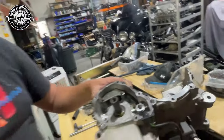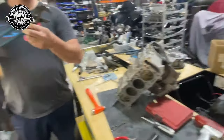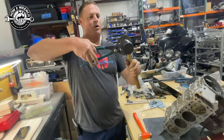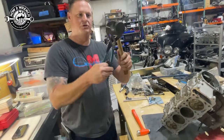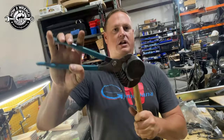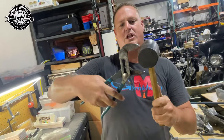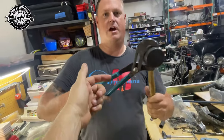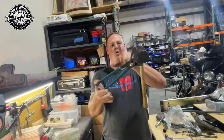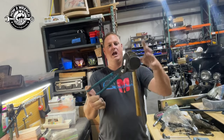Before you do that, can you show — just like on these, making a point, because you say you have to teach guys this all the time in the field. Just like a pipe wrench, your channel locks — if this was my pipe and I wanted to loosen it, this is the correct way. If you try to do it the other way, the force is going to keep trying to open the channel locks, so you're working more on keeping it closed and less on actually turning it. You're losing your grip because the claw pressure is being lost. When you do it the right way, you're literally putting weight on it to physically close it. You can hold it a little and smack it with a hammer and it would not lose grip because you're applying more force — this jaw is being pressed up into the bottom. You're using all your effort to turn it, not grip it.